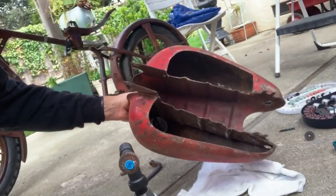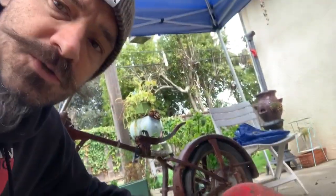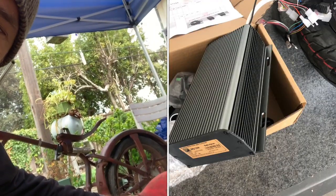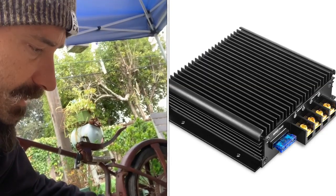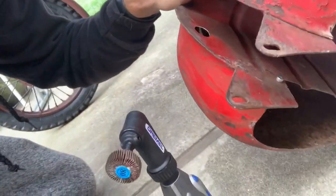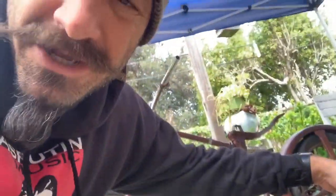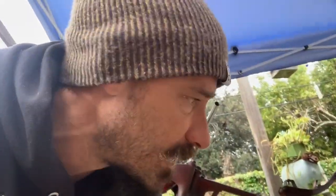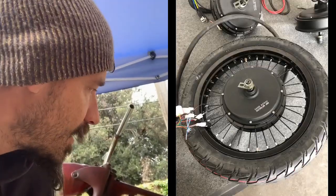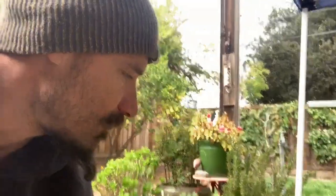The fuel tank was the only thing with a lot of rust on it, so I chopped it out — this is where I'm going to stuff the controller. I'm using a step-down to power my 12-volt accessories and the wiring. I'm actually starting to drill channels for the wires; I want everything routed through the inside so there won't be any exposed wires on the bike except for the main wire that leads from the motor up to the controller.